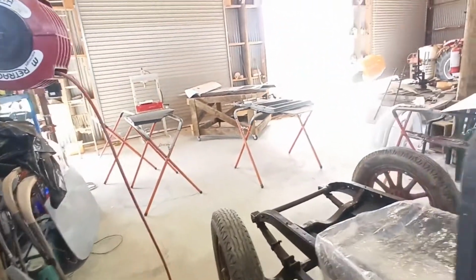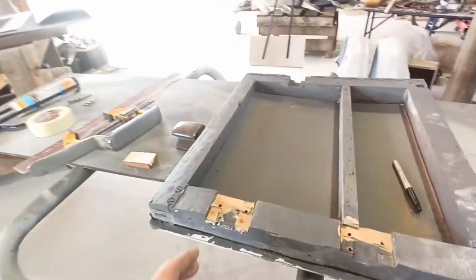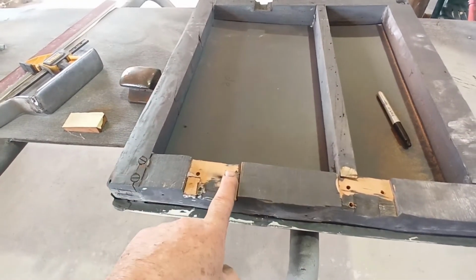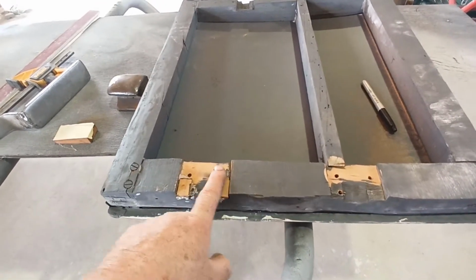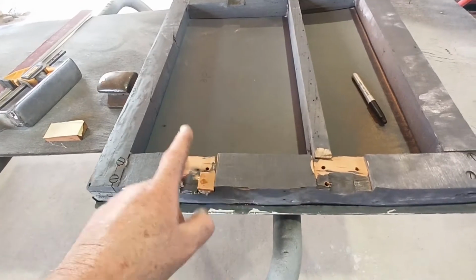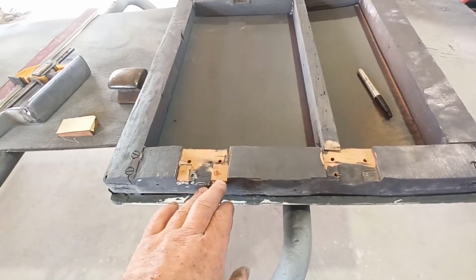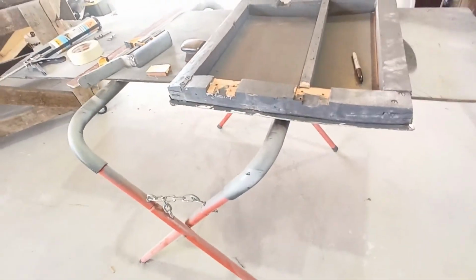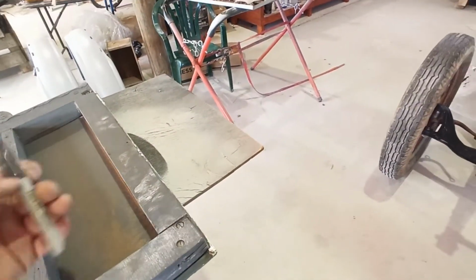So that stuff's glued up. This here hasn't quite gone off, but I'll just scrape it off. I'll shave these back with the little disc sander on the right angle grinder, and then see if I can get this to sit a bit better. I'll basically taper it back from this edge back into this and see how that fits, because I think that's part of the big problem.